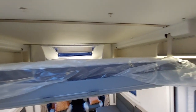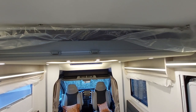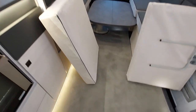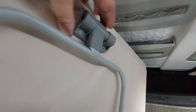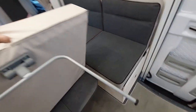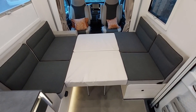Through the winter or during any extended periods of non-use, drop the bed down to about mid-height to allow the roof and bed to ventilate and prevent mould or condensation build-up. When the bed is raised, lights kick back in and illuminate that area. Making up the bed — there are two separate cushions: one without a frame and one with. The one without the frame goes onto the bed first. The one with the frame has an arrow on the mechanism that lifts up, and it sits at the opposite end with legs providing a little support to formulate the lower bed.